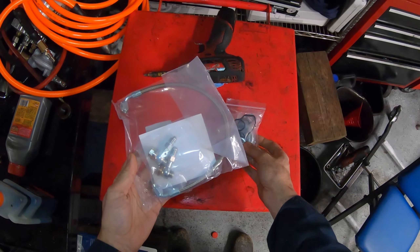We're almost there. There are a couple more 10mm bolts on top, a 13mm bolt in the center, and on the side a 10mm bolt to allow this support arm to swing out so we can get the heat shield off. Use a 10mm ratcheting wrench to loosen the bolt and allow the arm to swing out of the way. Now we can see the problem area — under here is where the turbo feed line comes in. We'll be removing this, and then this is the one bolt for the oil filter housing gasket that was hidden behind the heat shield.